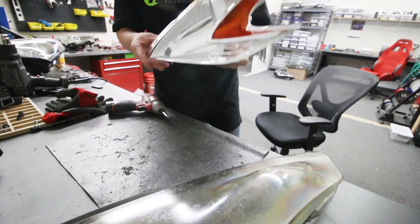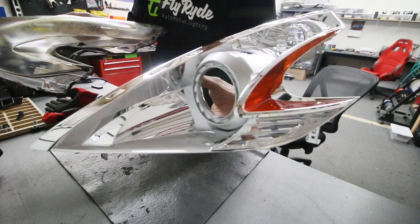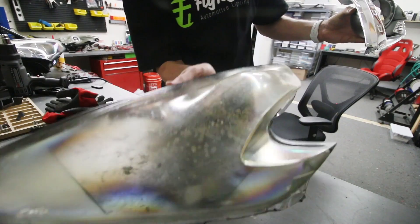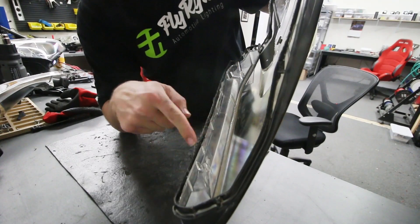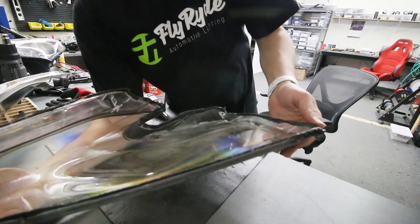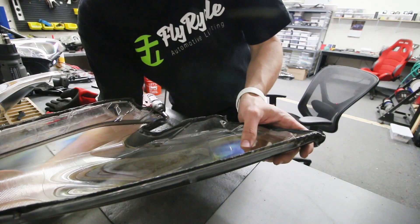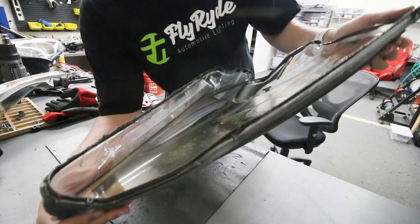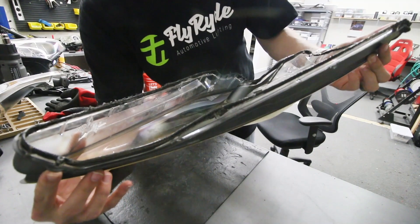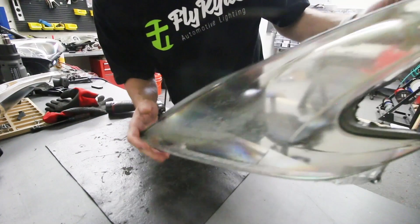Very carefully lifting the lens out — check out how bad that lens looks on the outside compared to how pristine the inside is. If it were clear, it would look perfect. When everything's modified and blacked out we don't want yellow shining through, so we'll put the lens back on. Important tip: the inside of the lens is not damaged. Never rub the inside with a cloth — you'll replace any cloudiness with fine-line scratches you can't remove. For almost everyone, just do a light rinse with water and soap on the inside and let it air dry; never wipe it.